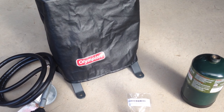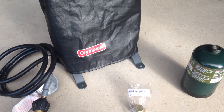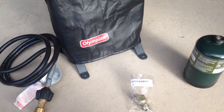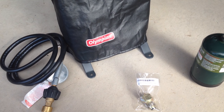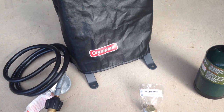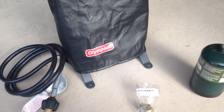The Wave 3 is the smallest one they make; they make two other larger sizes. This particular one is 1,600 adjustable to 3,000 BTUs, and supposedly it's capable of heating a 130 square foot space, which is more than adequate for a van. It operates on low pressure gas, no electricity is required, there's no fan, and it's silent because there's no blower. It is a catalytic heater and it is 99.98% efficient. It has radiant heat — it heats the objects around it or the objects it's pointed at, and then the radiant heat comes off of those objects.